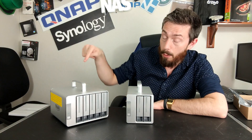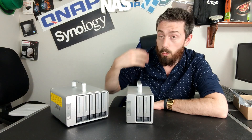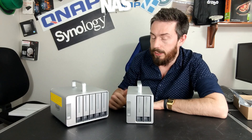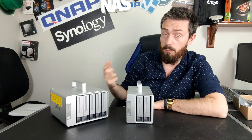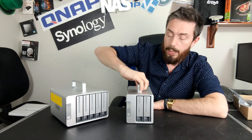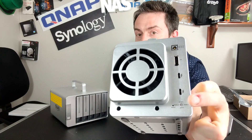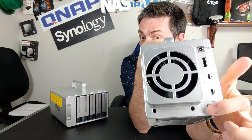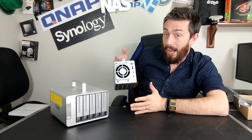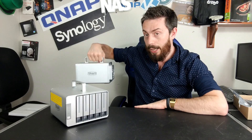This is a big deal for a number of you who may buy this thinking it's like the two-bay device, which has got hardware RAID. Hardware RAID can mean different things — it used to mean a PCIe card and a dedicated RAID-on-chip or SoC doing all the maintenance. On this two-bay you can look at the bottom and see a little dial where you set the configuration, and clicking the reset pin initializes the whole device, deletes any data, and sets up your RAID.